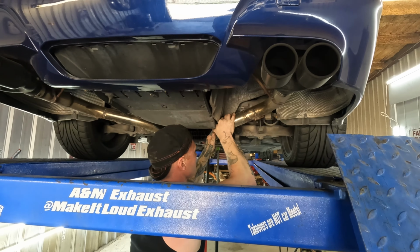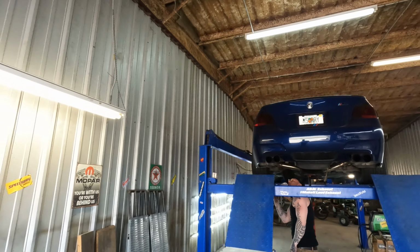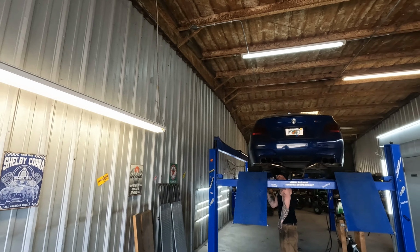Just one little tack right there. And then you could just rotate it. Because I think the position's fine, it's the rotation. Let's deal with that after we weld everything and let it go. If we adjust it on some stands before everything's welded, it'll move again.